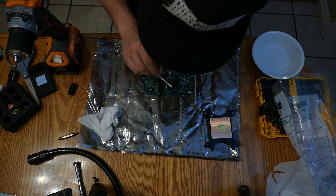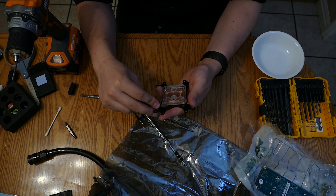I decided I was just going to reuse the thermal pad that was already on the memory chips, as it should be measured to the right thickness to keep everything flat. The graphite pad was very close to the same thickness as the pad that was covering the main processor chip before. I went ahead and cleaned the chips with some rubbing alcohol, filed down some of the rough edges on the cooler, and went to mount everything together. My original plan was to use the mounting screws that came with the water block, but they were just too thick to get through the holes on the back of the capture card. I brought the card to Home Depot and found an M3 bolt was the best fit. Unfortunately they didn't have one long enough, nor did they have nuts of the right size, but after calling around I found that Ace Hardware had exactly what I was looking for. I ended up buying 8 M3 bolts in 2 sets of 4 at different lengths, 8 plastic washers, 8 metal washers, and 8 nuts.